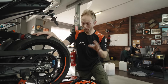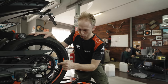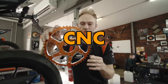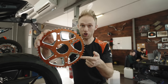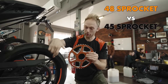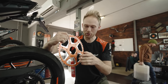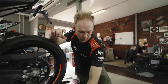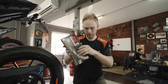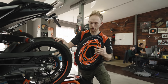Let me blow your mind already at the beginning of the vlog with tons of cool parts for the rear wheel. I want to change the stock sprocket, which is steel, with this aluminum CNC machined orange anodized one. The difference is also the tooth count — this is a 48-tooth sprocket versus the stock 45 — which gives better acceleration but a bit less top speed. Then we're going to add this orange chain, high quality, and our signature rim plates to finish up the look of the wheel.